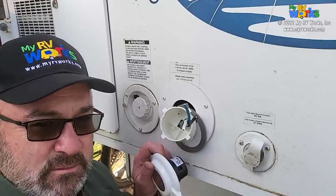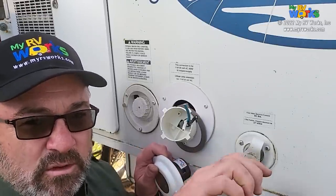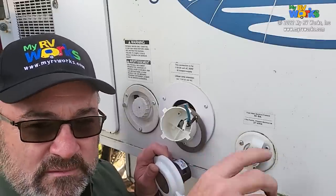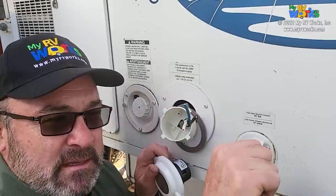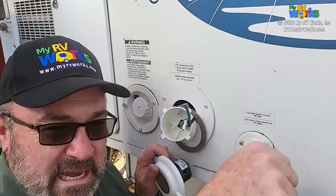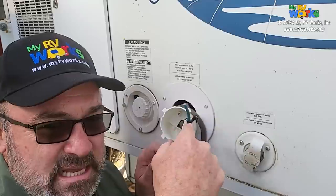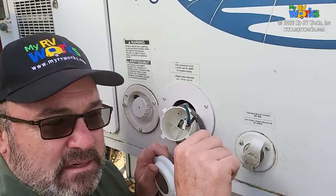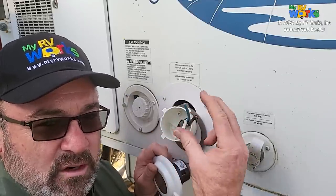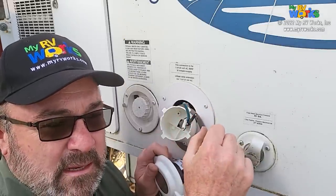I don't know what that is in Newton meters, but as many electrical panels as I've gone into to torque with my torquing screwdriver, after you do it enough times, you kind of know what 30 inch pounds feels like. It's right at the point where it's tight. Does that make sense? In other words, you don't want to tighten it so much that you're fatiguing this, but you don't want to tighten it so loose that it's not grabbing. There is a specific torque where you're elongating the strands and they grab really, really well.